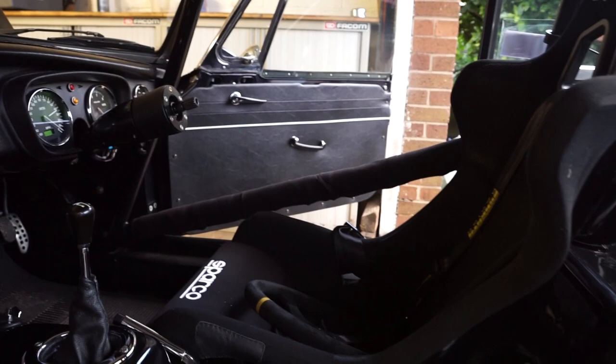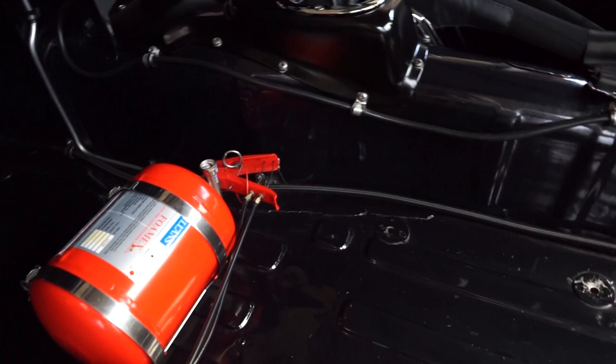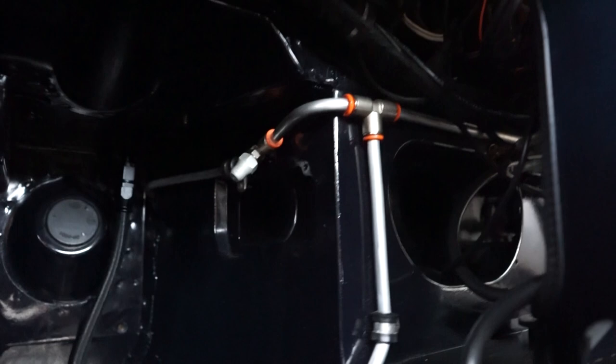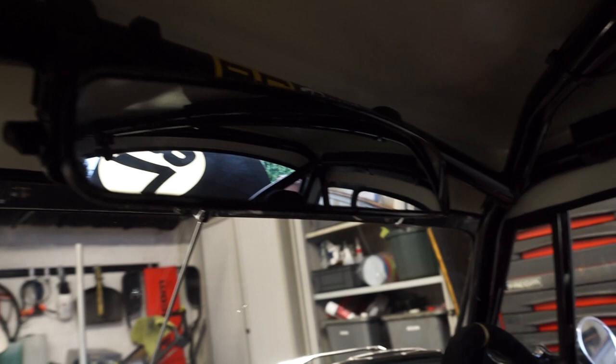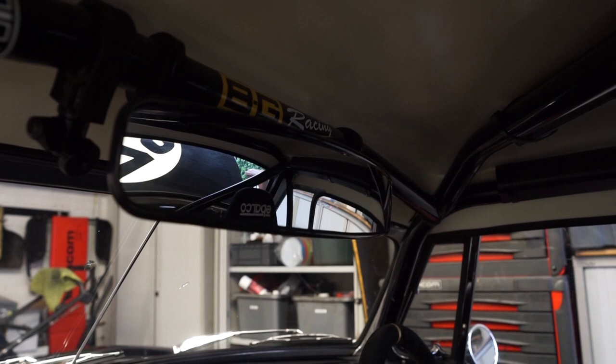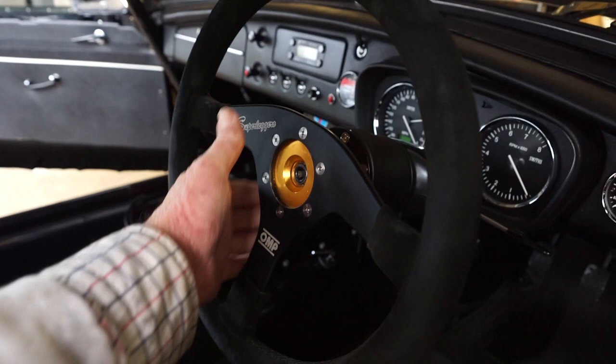The interior of the car is very basic - we've got no carpets, just a race seat and the full roll cage going front to back to keep you secure. You can see the fire extinguisher, which is a 2.25-litre fully plumbed-in system. The nozzles go into the footwell on both sides, plus two more in the engine bay. The standard MGB wing mirrors are really quite bad, so I've got a nice BG Racing wide-angle rear-view mirror that gives a really good view of the back of the car, especially useful when wearing a HANS device which limits your side-to-side head movement.